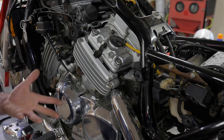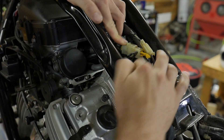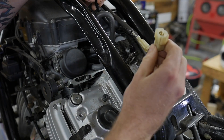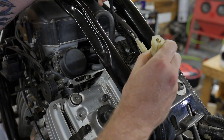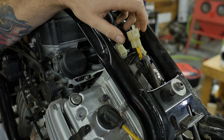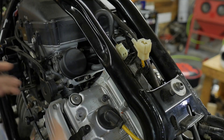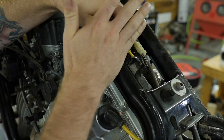Let's say we were not charging well, or it was very low or not charging at all — we're going to go to the stator. We follow this wire here and locate the connector right here in the bracket. When we unplug this, we have now isolated the stator. This is the stator side; this is the harness side. It's very important to know these two differences whenever you're testing anything electrical on a motorcycle. This same style of connector — these three wires — leads to the regulator rectifier as well, so there are actually two places you can make these checks.